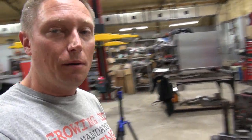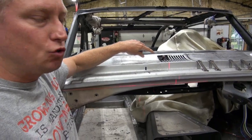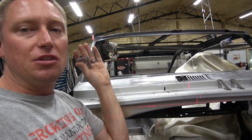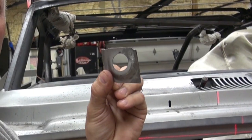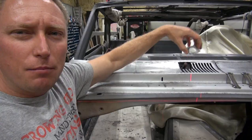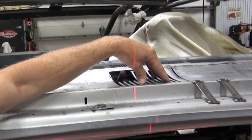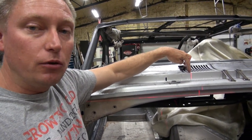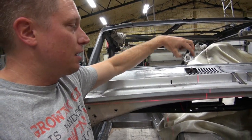I want to start by saying our starting point — I have my laser set up right there. The reason is I'm able to draw a line going from my wiper post right here down to the front of the cowl, then put a mark on the cowl. I'll do the same thing going in the other direction. That is later going to be important because I have this little piece that I've already cut out of the cowl — the piece that goes around the wiper post. I need to be able to relocate where that thing goes so I can drill the hole correctly, and I've marked it with a red grease marker.